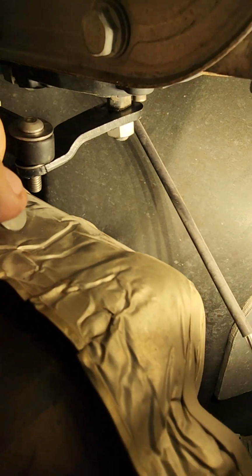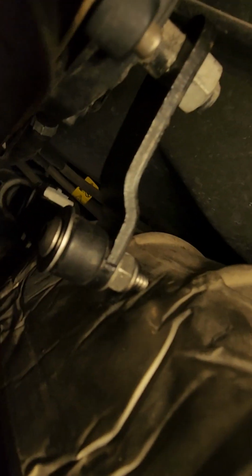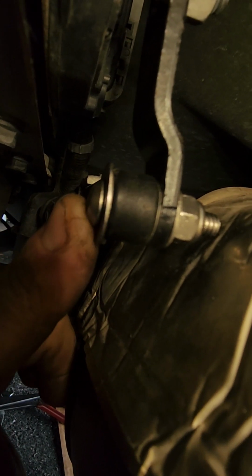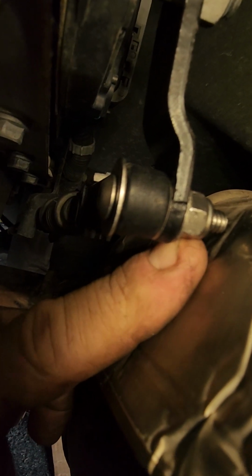Okay, continuing on here, you see how it's situated there. Now you've got to put the flat washer on and the nut. Now once you're complete, this is what it should look like. All said and done. By the way, the head on this side is an H4. This is a 12 millimeter nut, and that's a 15 up there. Now we've got to go inside and make sure.